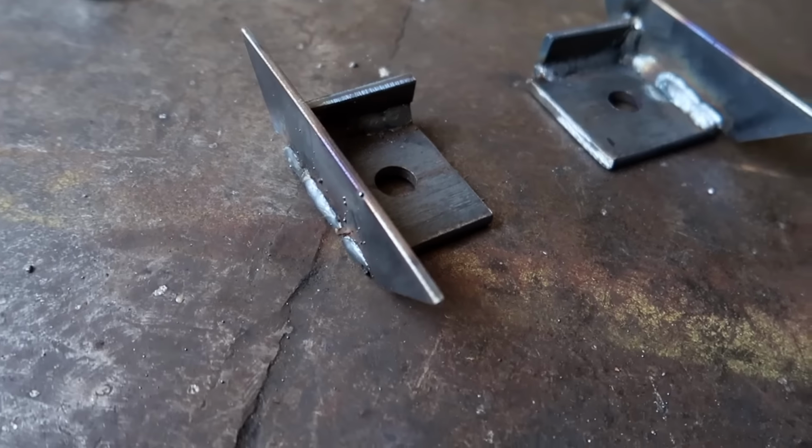Now I'm ready to turn my attention back to the mounts. With the hardware removed, I saturated the wood in epoxy resin and laid a piece of 6-ounce fiberglass around the hole. Then the hardware was installed with the screws, and the bolt is tightened into the T-nut from underneath to compress the hardware into the wood.